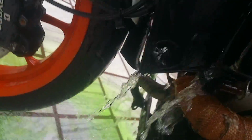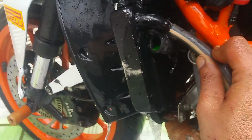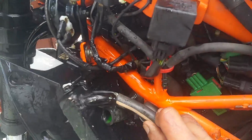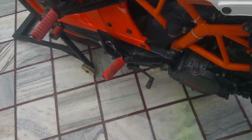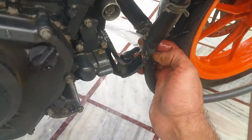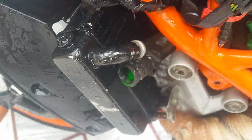It's quite green. So this is just the radiator flush. We're going to do the engine block flush as well. So keep this up until you see clean water come out of the other end. If you want, you can also do a reverse wash. Put the pipe inside this hose over here, and it's going to come out of this end over here. You see, it's pretty straightforward, no rocket science. Do this once in 50,000 kilometers.